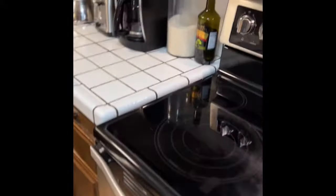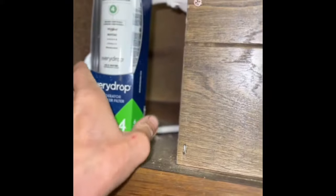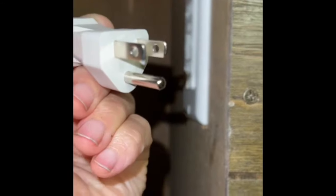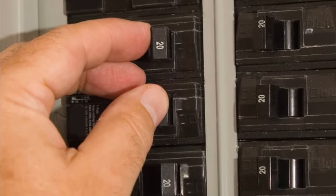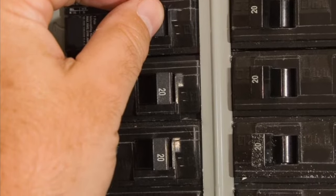The stepstool is good because it gets you up high enough to see how to remove a couple of the screws. We're going to stand on the stepstool, get up above the microwave, and open up the cabinet on one of the sides — you'll probably find a power plug for your microwave so you just want to unplug it. If not, you may need to go to the breaker box and turn off the breaker dedicated to your microwave.